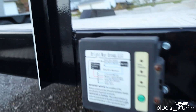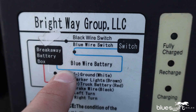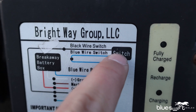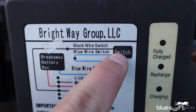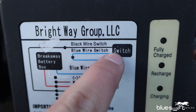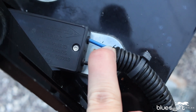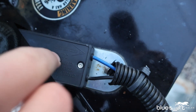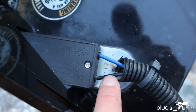When those two pieces of metal connect, it supplies power to the brakes. One end of your wire goes from the battery — your supply of power — to the switch, but right now it's not going through to the brakes because of that plug. Once the plug is disconnected, the two pieces of metal within the switch touch, it completes the circuit, and the power goes through the other wire on the switch to your brakes, stopping the trailer when there is a hitch malfunction.